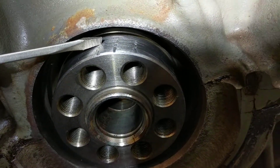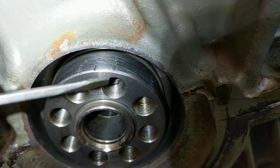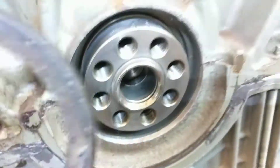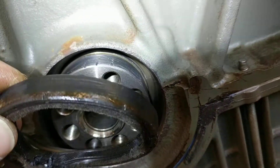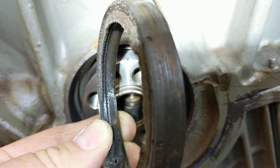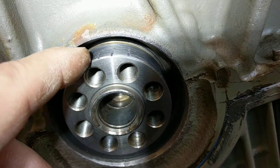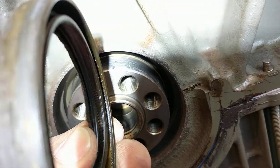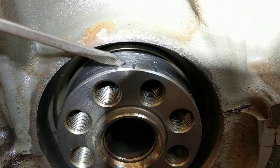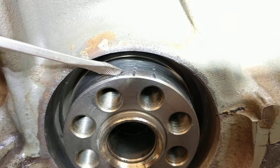The portion from about halfway down out toward the edge looks bad, but I'm not too concerned with that because of where the sealing surface actually is. Looking at the old seal, it sits basically flush at the edge of the block, and in cross section the sealing ring is actually closer to the inside edge — roughly 3/8 of an inch in from the end of the crankshaft. So these gouges on the outer edge, even though they look terrible, aren't really detrimental because there's no sealing taking place there.